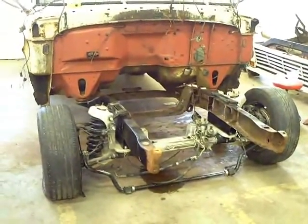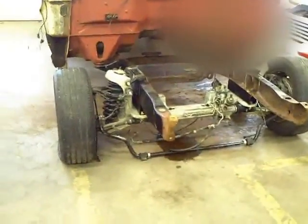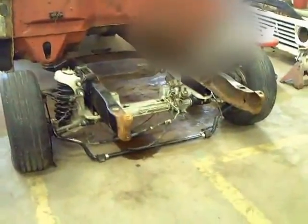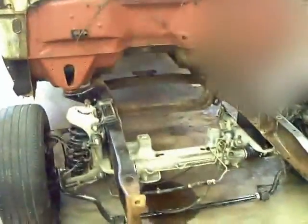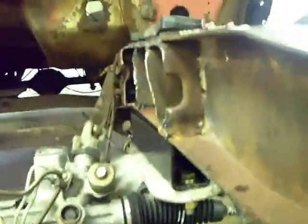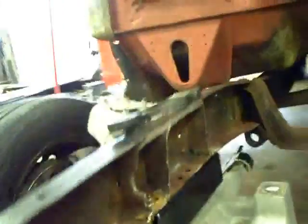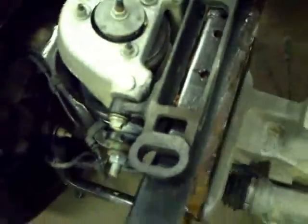It's January 20th, 2009. We've got the front end finally bolted in, at least most of the way. The top brackets we're still working on — we had to flip them over and swap sides because we put spacers in between, so we had to take some metal off the brackets on top so they'll bolt down firmly on the top of the frame.